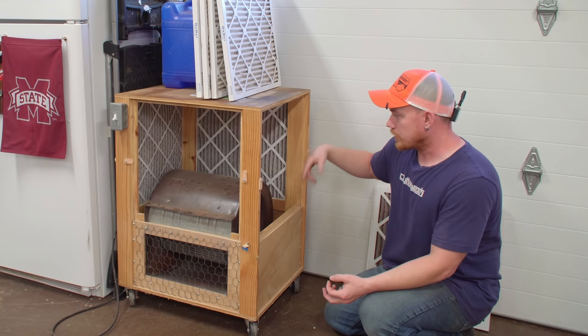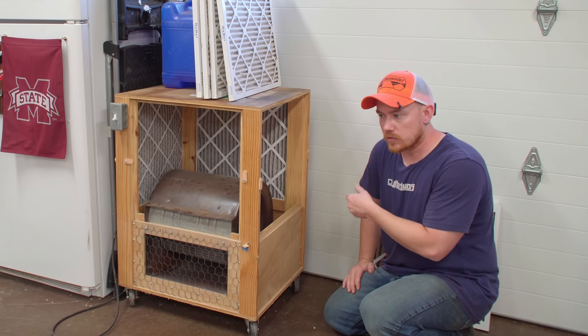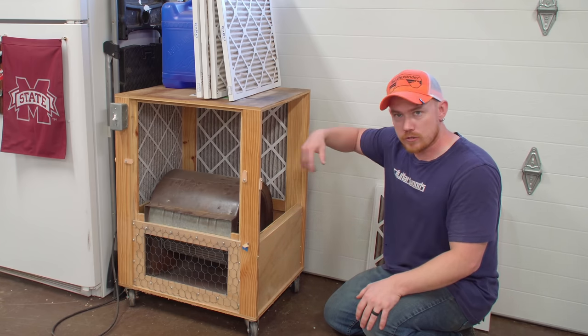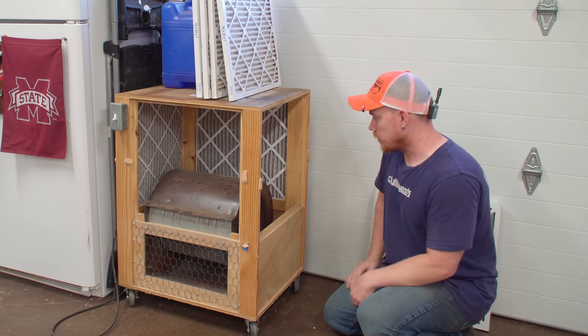It did have a tag on the motor for the proper amperage. After I put it all together and restricted the airflow a little bit, I put an amp meter on the wires, and I was within the specs, so I'm not going to burn up the motor. Something you don't want to do is have not enough restriction of the airflow, and then these just run too hot and you end up burning up the motor.